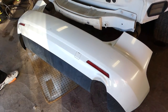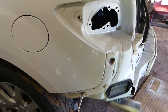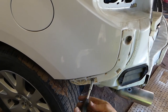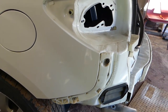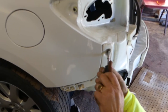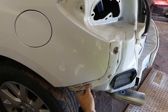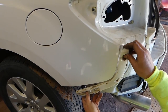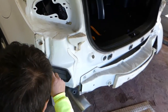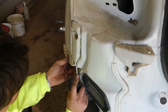Once you remove the bumper cover, the side bumper mount is right here. Go ahead and remove it with an eight millimeter socket — it has only two screws. Sometimes those get damaged and your bumper might be hanging, or they'll crack since it's just plastic holding the bumper — bump them a little and they might break easily. Once you remove the two screws, there's a clip, so pry it out of there — that's the one that centers it in place.